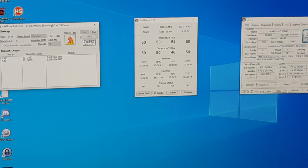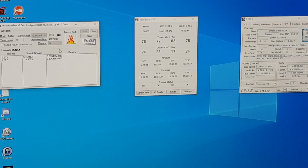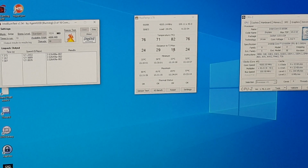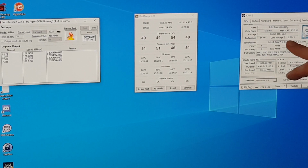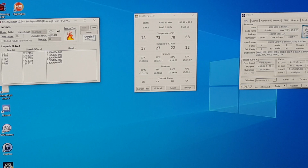Okay, so we're on to cycle 6 of the Intel burn test now. Unfortunately, in the first round of testing, I got a blue screen on the 3rd cycle, so there was a stability issue. I've been into the BIOS and I've upped the core voltage slightly again. I went up to 1.29, but you'll see if you look here that the actual voltage we're reading is varying between 1.304 and 1.312. That's still fine. But obviously, the higher the voltage, the more temperature you're going to get.